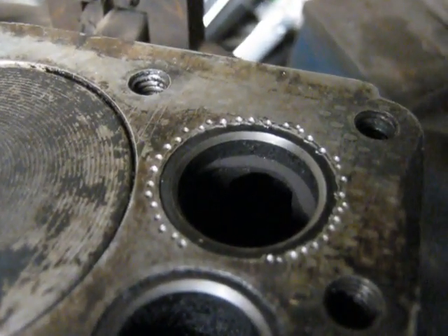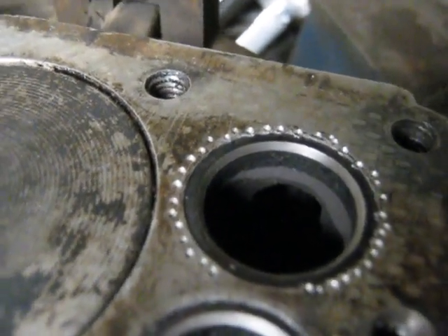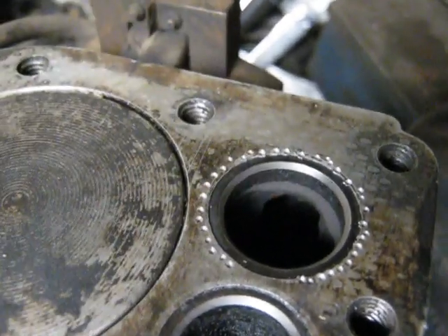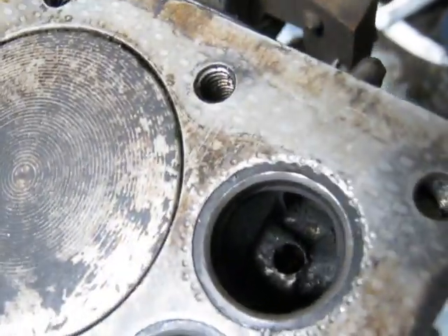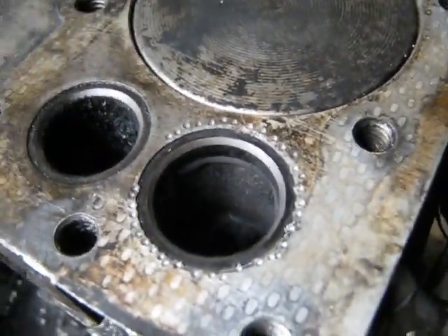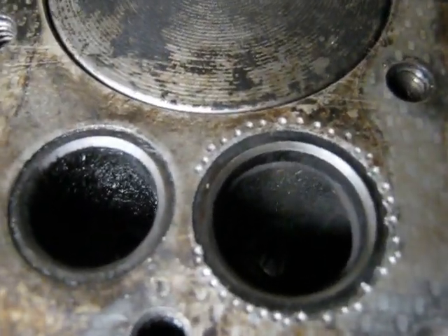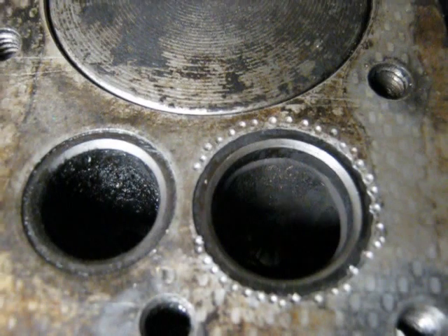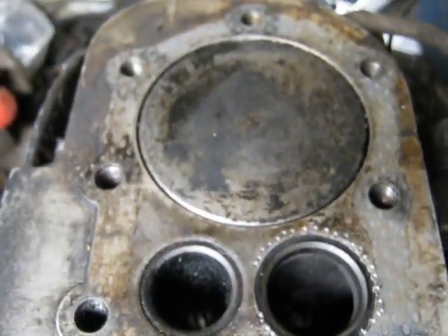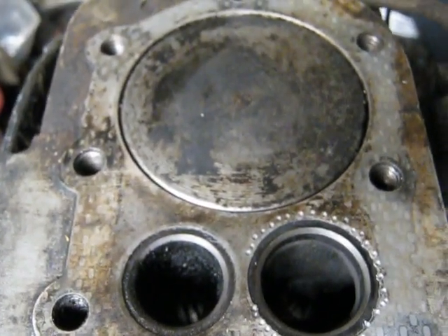I've done as much as I'm going to. I'm not going to do any in the area between the valves — it's pretty close and I just don't think it needs it. Now I need to wipe the excess JB Weld out of the seat area, making sure I don't get it anywhere I don't want it. I imagine this engine will run just fine. I'll be testing this engine on an upcoming Frankenbriggs project, so I'll let you know which one it is at that time so you can see the results.